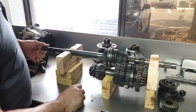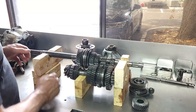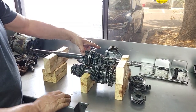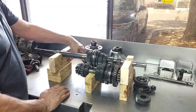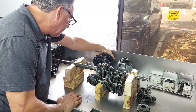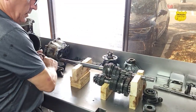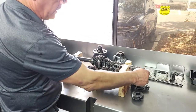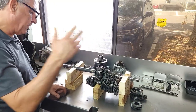So what else is going on? Well, we need reverse. We have fifth gear here in the back. You can see all our other gears are small driving larger, then when we get to fourth these gears are just about the same size — I believe it's one-to-one, so the number of teeth would be the same, and engine RPM equals pinion RPM. The final gear ratio on this ring gear, I think we figured out, was 8 revolutions to 27 revolutions or something like that. So fifth gear is a slight overdrive — this one is now turning that one a little bit faster. But once you have the momentum and speed, you can do that.